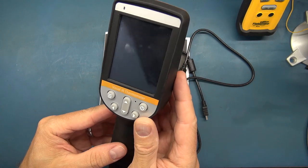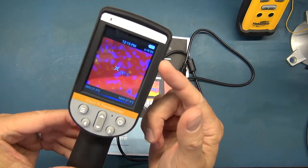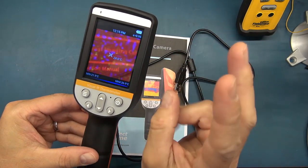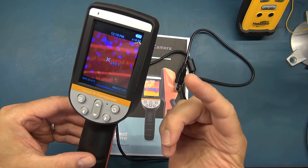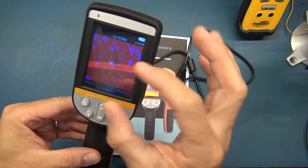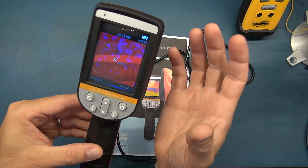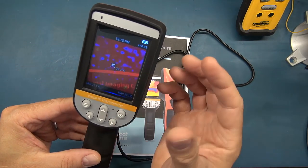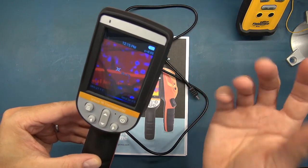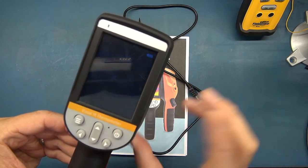I'll note the one issue I have with this device. It can be left in sleep mode and comes on straight away. But if you fully shut this down and boot it up, it's a fair wait. When I do a full shutdown and power it on, it comes up with the battery icon as if it has no charge — it's just not seeing the voltage properly when it boots up. I have to plug it in; as soon as I do, it boots up, I can pull the cable and it runs fine. I just leave this in sleep mode.